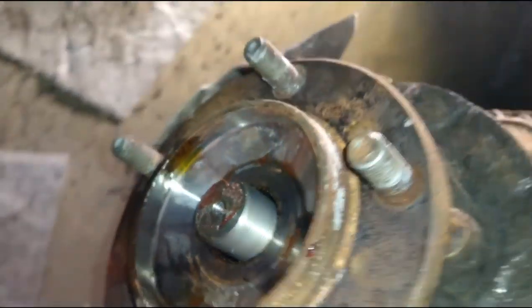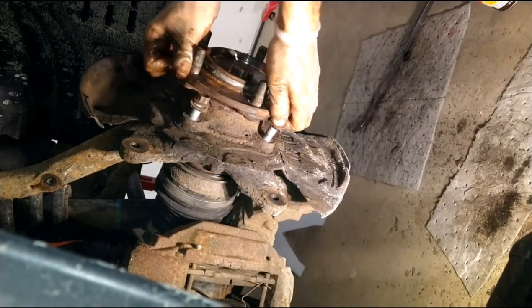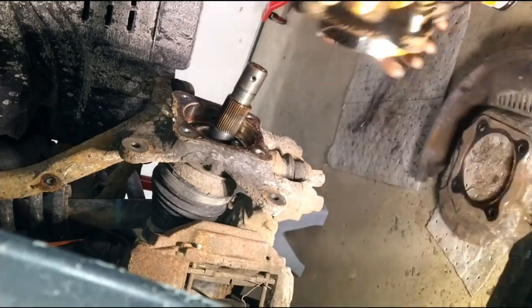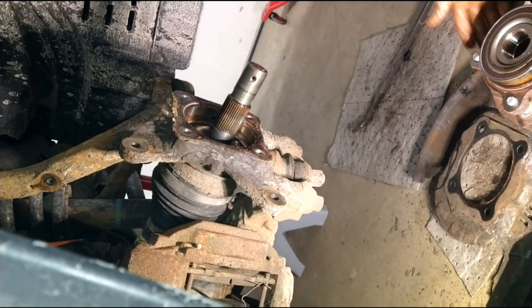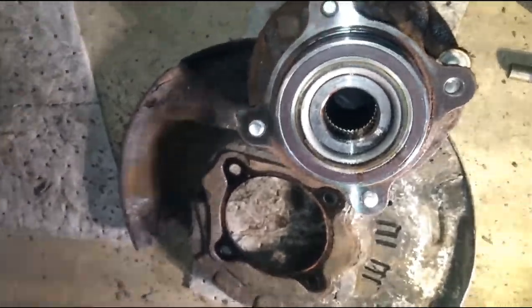You can see I do have the axle quite far back. Now I'm just going to remove all four bolts and pull this guy out. These bearings come out basically by hand for the most part — I don't even have to tap them because they're pretty protected inside their knuckles. This has an O-ring here which seals it, seals rust from going in. Same thing in the back — another seal for the axle for any debris. There's the bearing out. Now I need to press the hub out, swap bearings, put the old hub back on the new bearing, put the old bolts on the new bearing, then press the hub in.